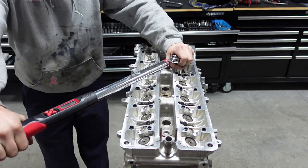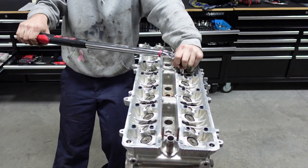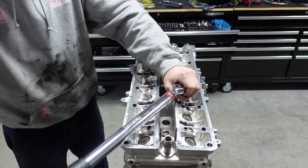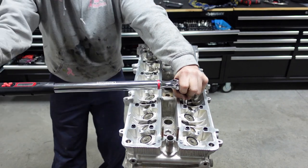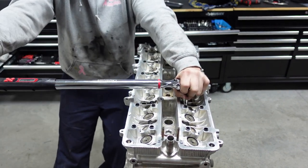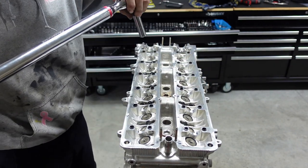The reason I go a little bit extra is I don't want to take any chances. You just don't want to lift the head on these. You can see it takes a little bit more strength, and this is a big bar. Usually I use a 3/8. I'm using a 1/2 inch this time around, guys, so it usually takes a little bit more oomph. I figured I'd talk to you. I know I had music before this, but it takes some oomph to put into this.